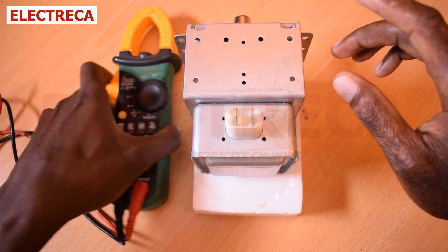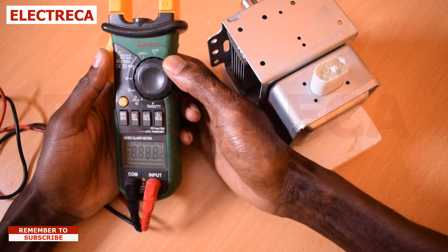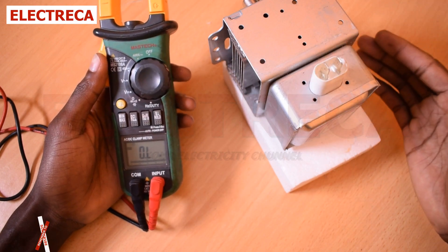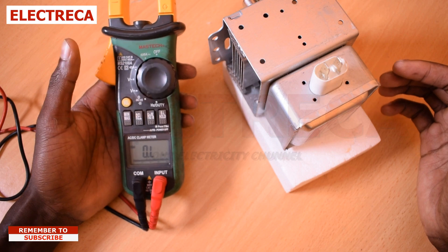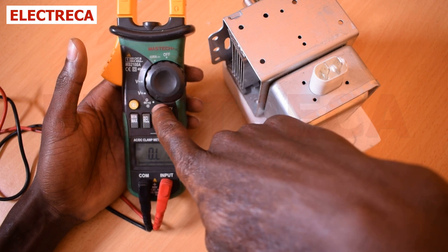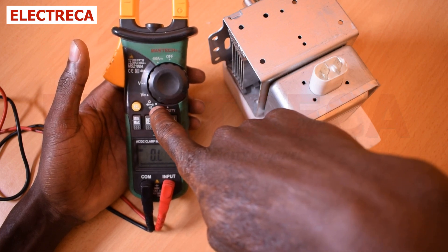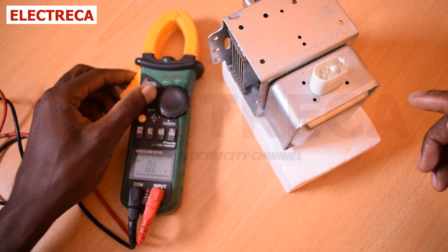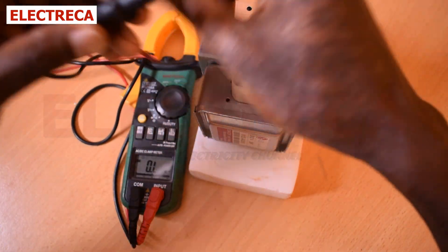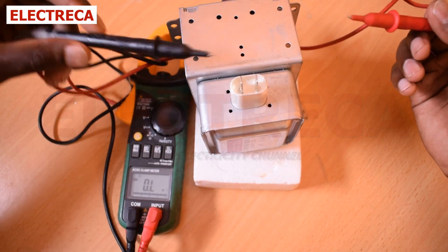You need to turn on your multimeter. There are many different meters, but you have to set your meter where you see ohms, semiconductors, and continuity. They have settings for your diode, ohms, and a capacitor symbol. We should get values around one ohm — that would simply tell us that our magnetron is fine.